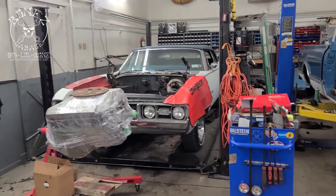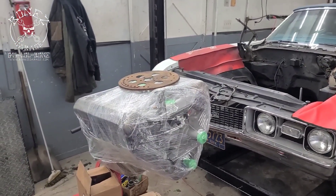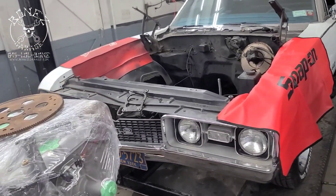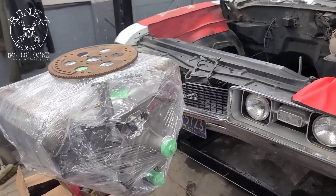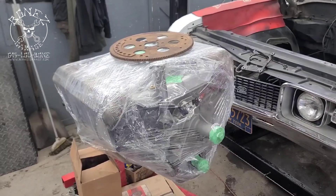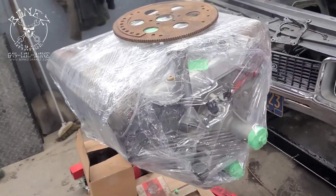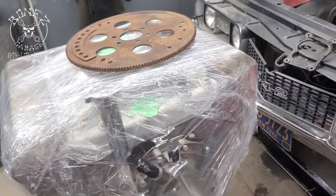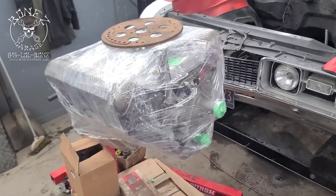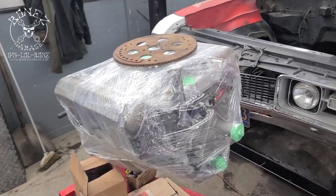She's coming out really good and I'm really excited to get it in. We've got some nice long-tube headers going on, a two-and-a-half inch exhaust system, and Super 44 mufflers out back. There's a really nice cam in here — this thing is gonna sound really good and have gobs of torque. It should run reliably, and we're at 10-to-1 compression so you can run pump fuel no problem.